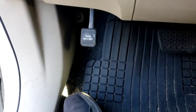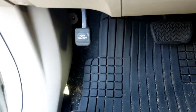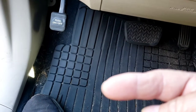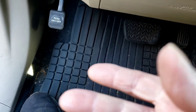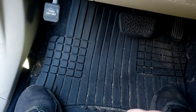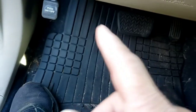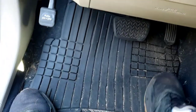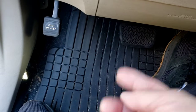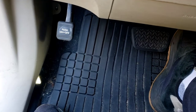I'm going to say the cable was still working. What we're going to do is start the car, put it in drive or reverse, step on the brake, and see if it stops the car. If it does, you know the cable is good all the way down to the back wheels — it pulls the two emergency brake drums. They're inside the rotors, little brake shoes like a drum setup inside the rotor hat, a primary and secondary. One cable goes down then splits into two — left and right.